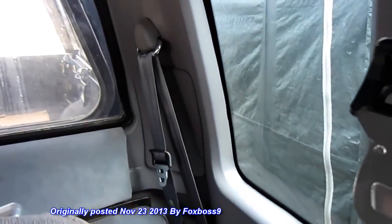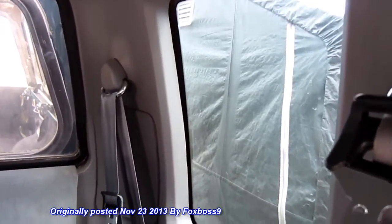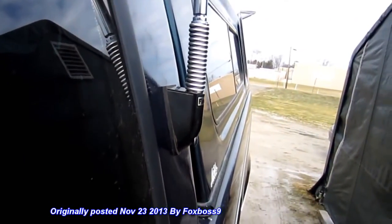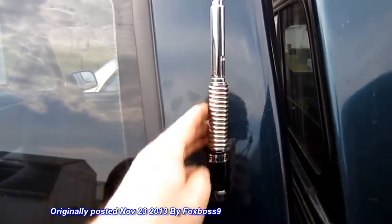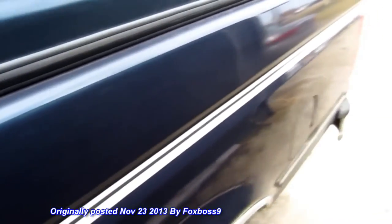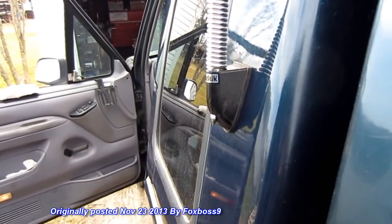I had to take out all those panels to access the panel inside. Everything's double-walled in case of rollover, so I had to find a hole — the speaker grill hole was just perfect to get to where I could mount that plate. I don't recommend doing all this trimming I did here, because it was a little bit labor intensive. It leans in slightly but hardly at all — doesn't bother me. This is a top-loaded antenna; the Fire Stick 2 is what this is. If you want to mount it lower or on the back of your vehicle, this would be a good mount right out of the box. If you have any kind of angle though, there's no way to accommodate that unless you manually trim it down.